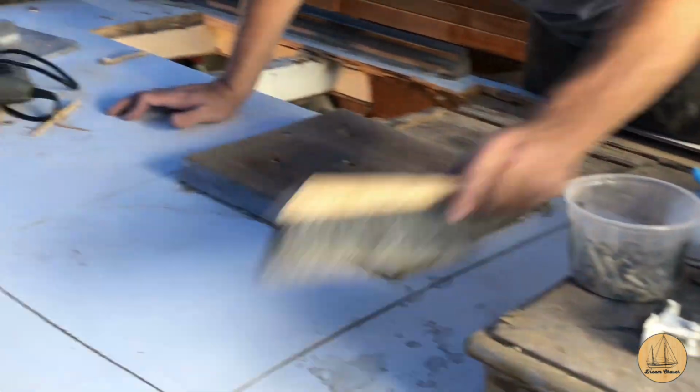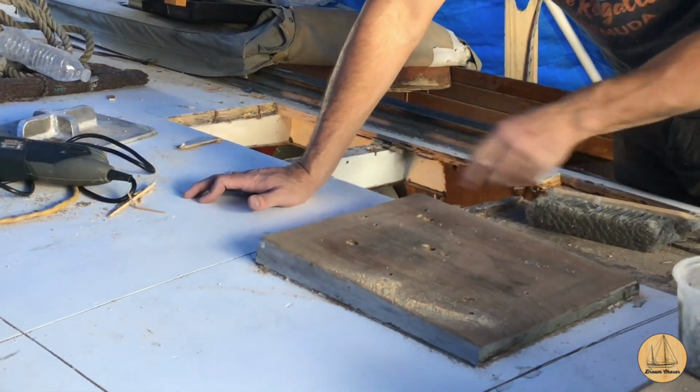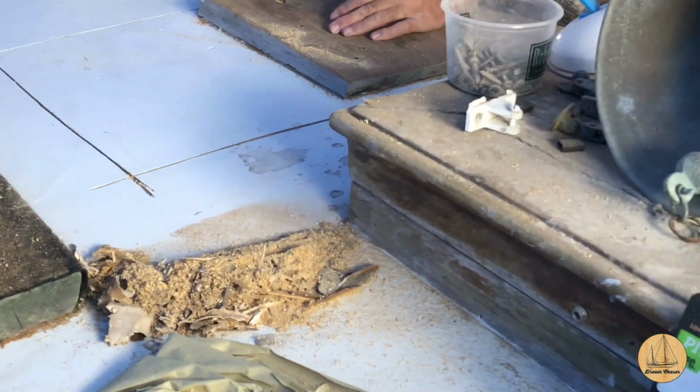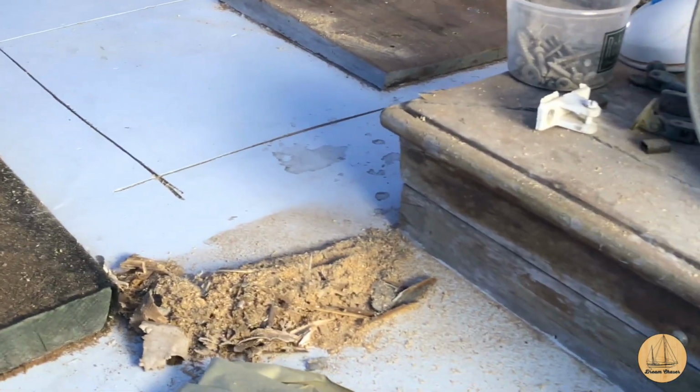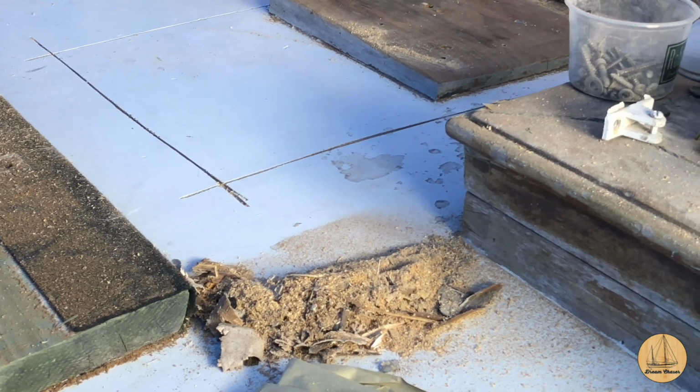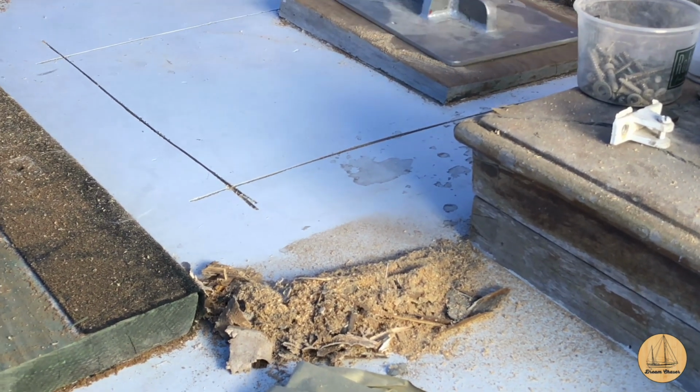Yeah, I think it's... Over on this side, it's a little rotted under that mizzen step. So I want to pull the screws out, pull this piece off. We'll put new core down, re-glass it, and then this will get screwed down on top. But I got all the measurements to know exactly where to put this back. And then it already has the holes drilled and ready to go for the mast step, which is where you'll put your coin right inside of here.